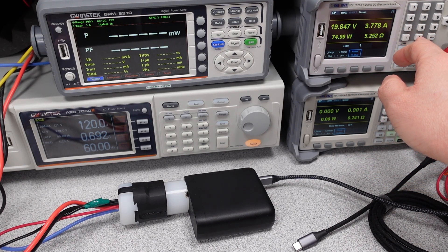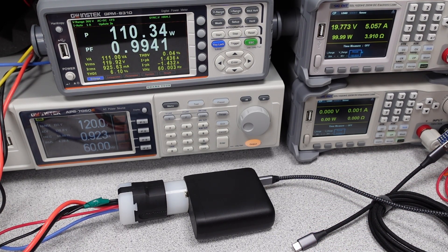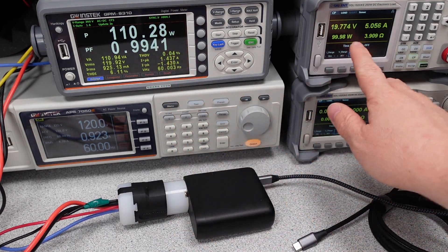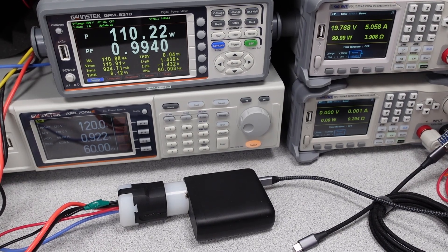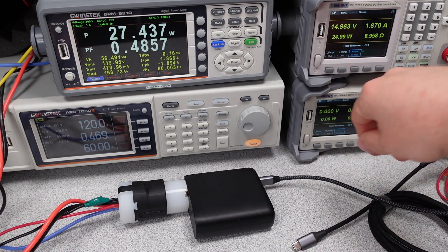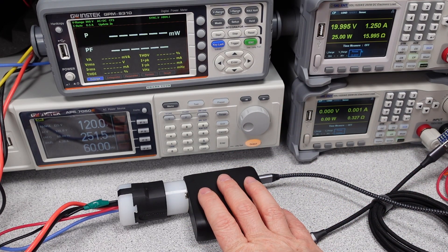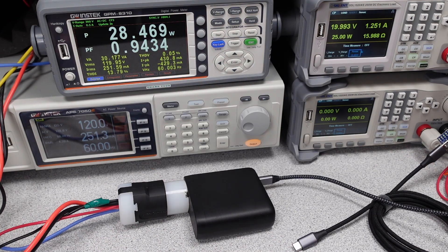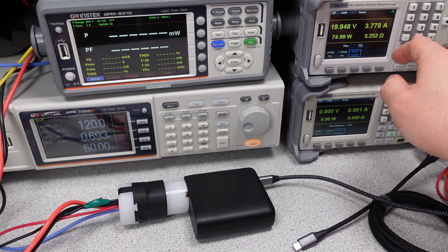Almost all of these adapters met the claimed Department of Energy Level 6 efficiency and idle power level for their respective tiers. The 5-watt did not meet the active efficiency requirement, which often 5-watt adapters don't meet. Things start to change when switching over to 230 volts and 50 hertz — right away I see issues with the EU-20191782 certification on the Amazon 100-watt adapter. With the larger size of these adapters relative to their power levels, the surface stayed within a reasonable temperature during operation; less than 60 degrees C is considered normal. The output voltages were within USB specifications and stayed strong during all tests — when it says 20 volts, you get 20 volts.